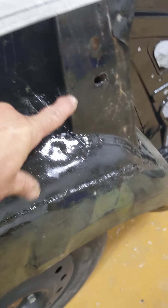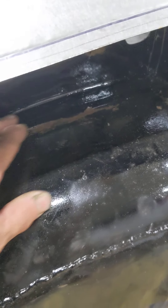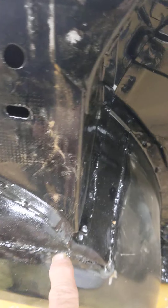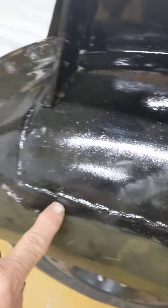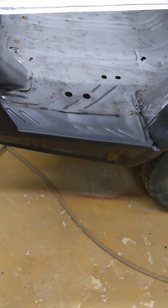What I did was, if you take a close look in here, you can see there's a bunch of beams that come down — supports — and then there's another one back in here. And then all the way in the back, the outer wheel lip is underneath this piece coming down, so there's a lot of stuff to tear apart in there. It would be hard to do and probably tear it up. So what I did was, I took and cut all around it, cut that section out and welded it in. And it fit real well, didn't have any problems at all.